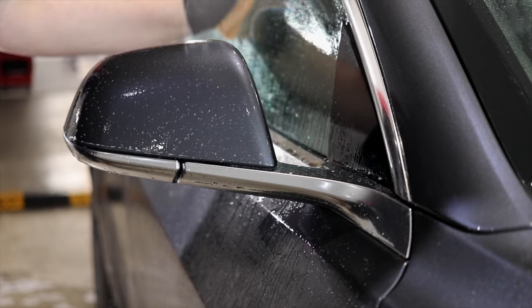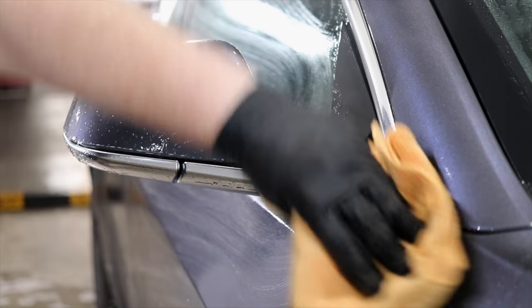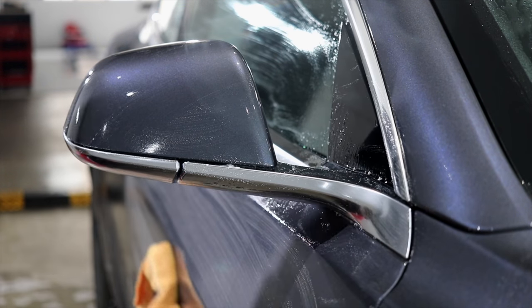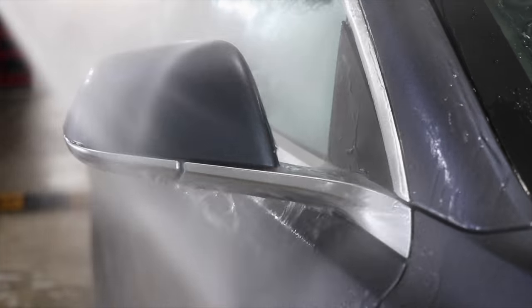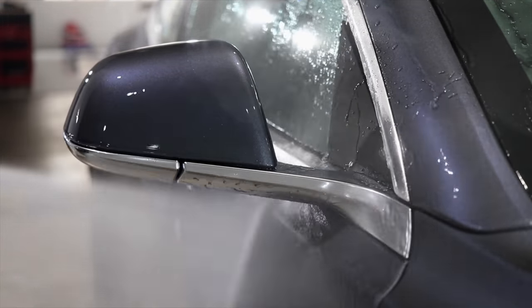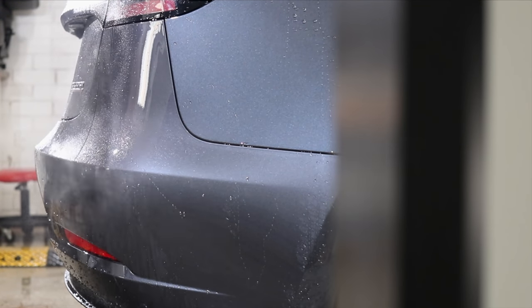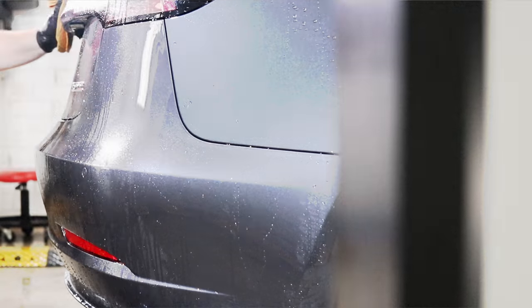Using a microfiber cloth to wipe the chemical over and into the paint is what really allows you to effectively remove that environmental fallout. And the difference between just spraying and rinsing it off compared to working that chemical into the paint with a cloth makes all the difference. So after using the iron remover with this technique, not only was I able to remove all signs of those existing particles, but I also saw the water behaviour further degraded, meaning that the paint was truly clean and bare and ready for the paint correction stage, with no need or benefit whatsoever in claying the paint.